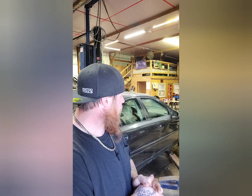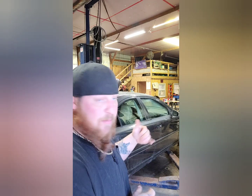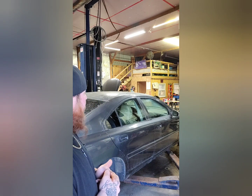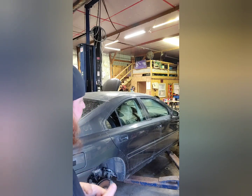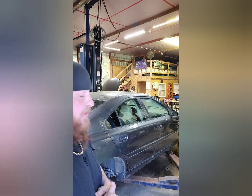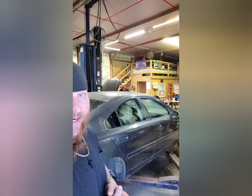Since it's a junk parts car, I'm going to set it down, move the lift back a little bit, and drop the entire subframe right out of the car. We don't really have to worry about keeping the harness or anything like that. The benefit of dropping the entire subframe is there's only a few things we really have to disconnect underneath, such as the drive shaft — I got to disconnect that rather than cut it.